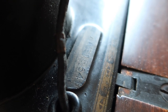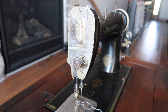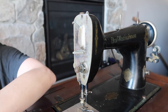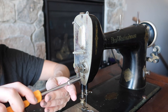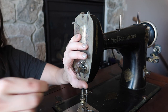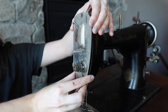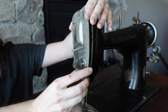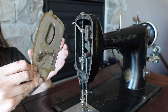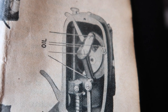To start with the restoration of the sewing machine, I'm going to start with the front plate - or I think it might be called the face plate of the machine - which is only held on by two screws. I took off those screws and delicately removed the front plate. This front plate is actually meant to be removed as you do maintenance and oil the machine regularly. I find it absolutely fascinating that a key part of the antique sewing machine manual was detailed diagrams and dedicated instructions on how to disassemble and properly oil and care for your machine. You definitely had to be a bit savvy with moving machinery parts in order to properly care for your sewing machine.